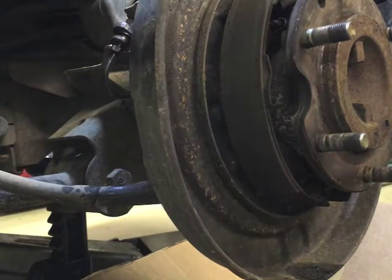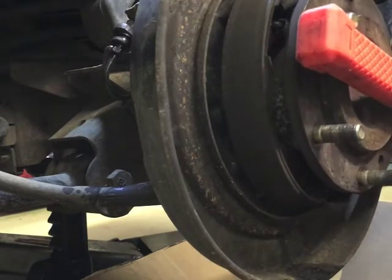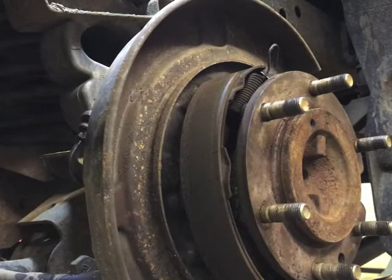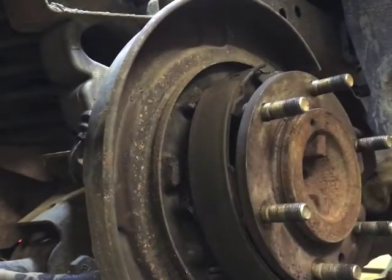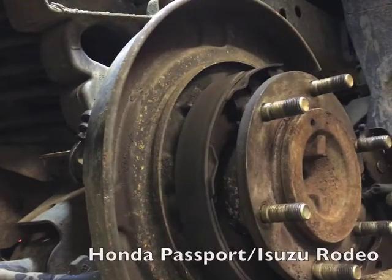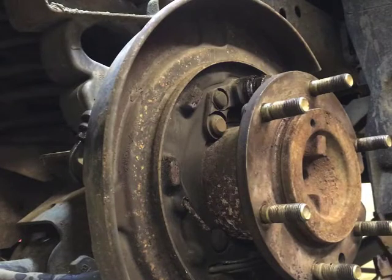This may or may not be chock full of asbestos, so don't go blowing into it with the air hose and then breathing deeply. This would be a great time to replace these shoes. I've actually had this brake apart before and discovered the shoes looked exactly the same as the new ones I'd just bought — they just weren't adjusted right. Obviously you don't want to mess up your hardware if you can avoid it. I'm told it's getting a little difficult to come by, although apparently there's a Honda Passport kit that you can use — I'll throw a link in the description to that thread.